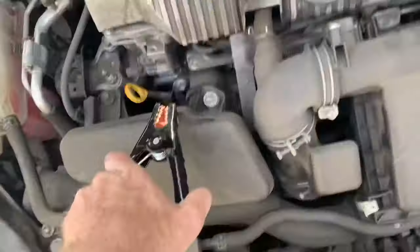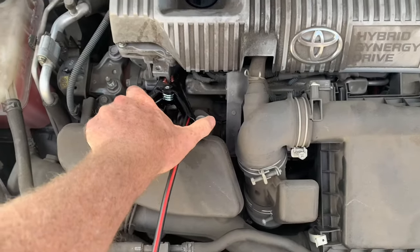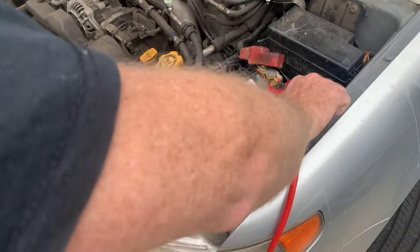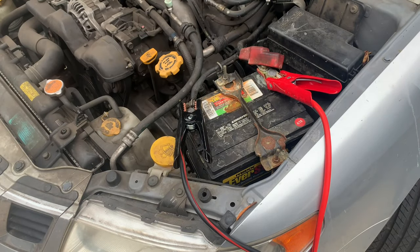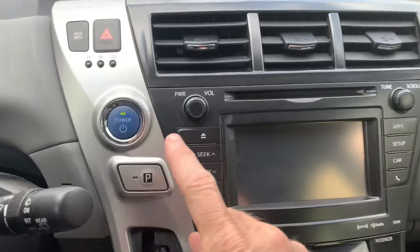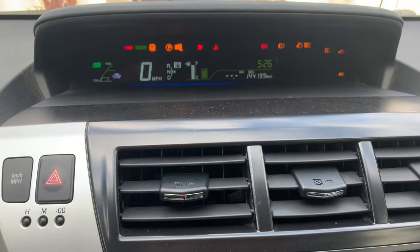On the left side of the engine block is where they recommend clipping your negative terminal, so that you've got negative to ground. You could clip it somewhere else that's grounded as well if you can find a good ground. Then you hook it up to a car battery and start the engine of that car so the Prius gets a little extra juice. Let it run for five minutes, get back in the Prius, push the power button, and voila — you're back in business.